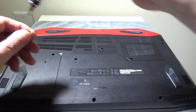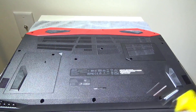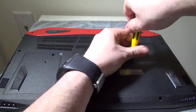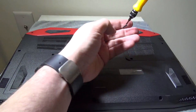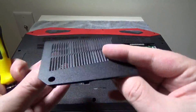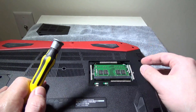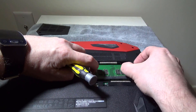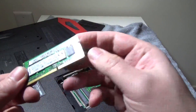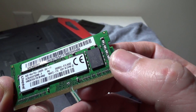As far as getting into the M.2 drive, I will cover that at the end of the video. Let's take a quick look at the RAM slots. If you want to take out the two 8-gigabyte Kingston RAM sticks you can, and put in two 16s — it will support up to 32 gigabytes. It's just one screw removed, pull up, and there are your RAM slots. There are tabs on the sides — little metal tabs — and you just pull those to the side and it'll pop up at an angle. Then you just pull it straight out and there is your 8-gigabyte Kingston stick.